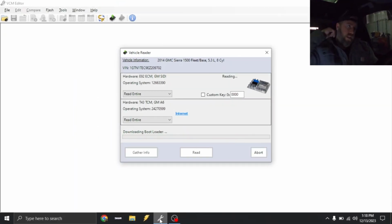All right guys, change of plans. Went to start the truck up to pull it back on the rack, and it's entirely too rich. The base file for this thing still has the 5.3 injector data in it. So we're just gonna go ahead and load in the LT4 injector data and go in and build a base file. Right now it's physically producing smoke out the tailpipe, and obviously I'm in a shop with a bunch of guys working. I don't want to do that to them.